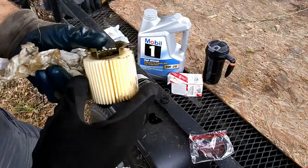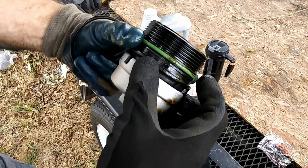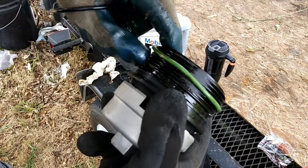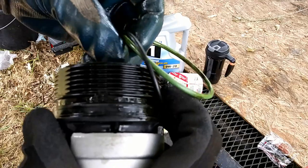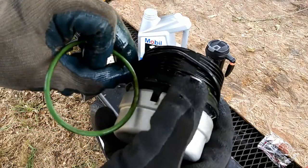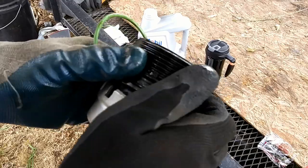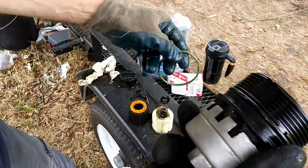The filter goes in all the way and your spring goes right there. With O-rings, just like in transmission work, grab it and pull toward your other thumb to force it up a little bit. If it's really brittle you might have to reach in with a pick. Never throw an old O-ring away until you've successfully installed your new O-ring and double-checked for fit — if there's something wrong with your new O-ring and nothing wrong with your old one, the old one is better than nothing.